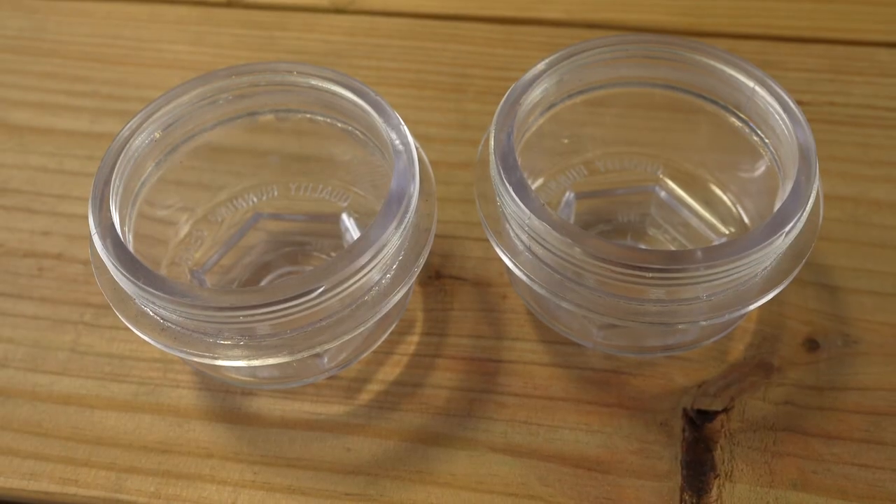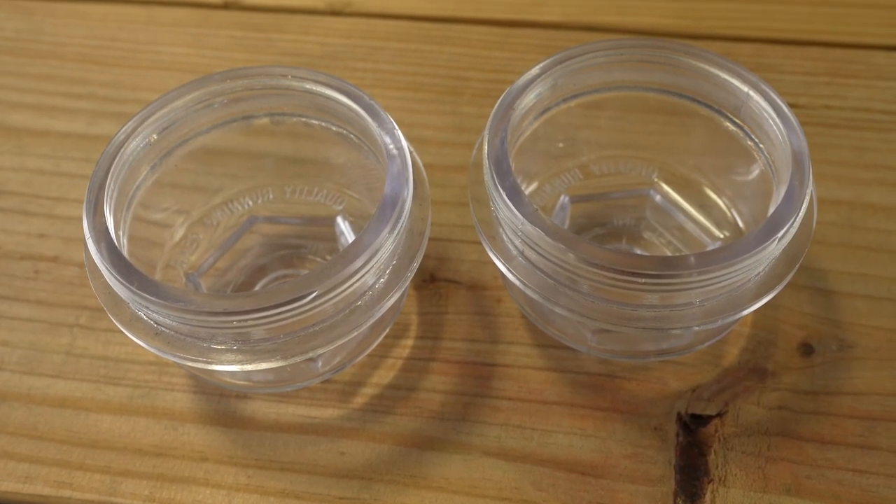Secondly, if it breaks and you're hauling something, you're stuck until it is fixed. There is no wiggle room or grace period before things get damaged. If you have an oil bath axle, it would be a good idea to keep oil bath caps and some oil on hand just in case you break one of these caps so you're not stuck.